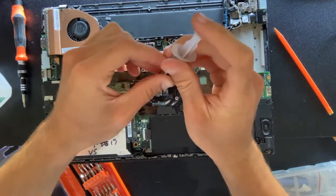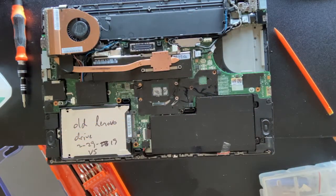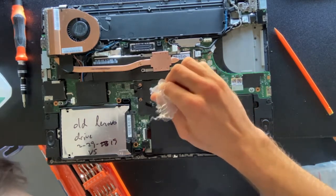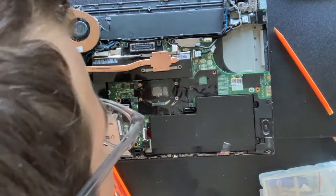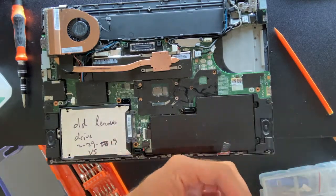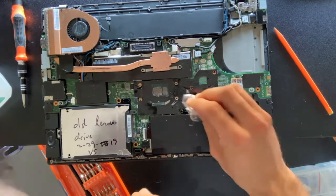You don't want to add way too much, but enough. Then use a plastic cover over your finger to help spread the thermal paste, because you don't want any contaminants getting into it — you want to ensure the best thermal conductivity possible. We're just making sure we get the best cooling performance out of our laptop and take advantage of maximum surface area for heat conduction.